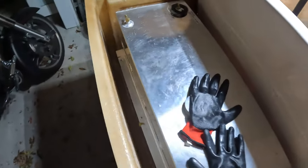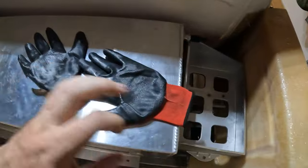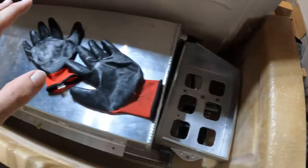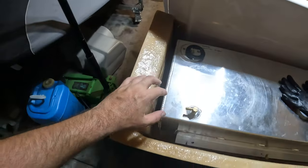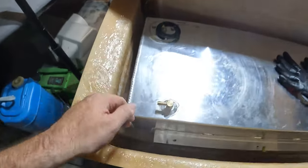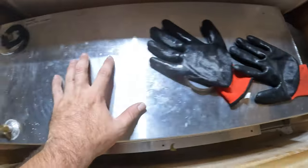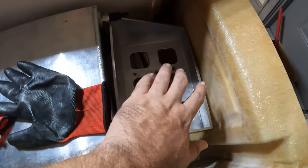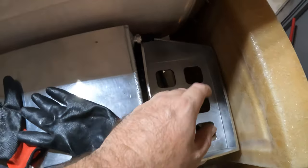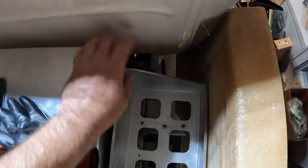As in episode 4, we did get the gas tank actually installed, as well as the battery box, but I had to pull all this out because I didn't realize that the body itself was such a tight fit that it wouldn't actually fit over any of the seams down here. So we did pull that out. We're gonna end up getting that remounted. But we had some other stuff that we had to address over here, which we'll come back to, as well as a little bit of an issue with our AN6 fuel line fitting that comes out here.